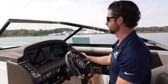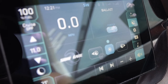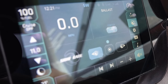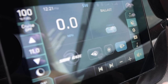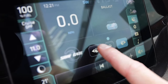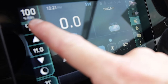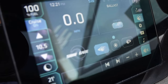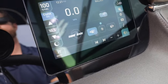To set this boat up for surfing, you first hit the SurfGate screen and turn on the ballast — it automatically turns off once the ballast is full. Then you select the side you want to surf on: if you surf on the left-hand side, the surf gate deploys on the driver's side; if you surf on the driver's side, the surf gate deploys on the passenger side. Jared is a regular surfer so we'll let him surf on the left side. For speed, turn cruise on — most people surf between 10.5 and 11 mph — and trim will adjust the surf wave while Jared gets back there.